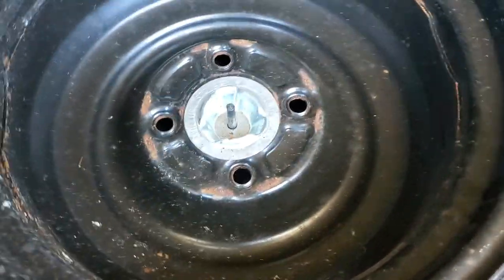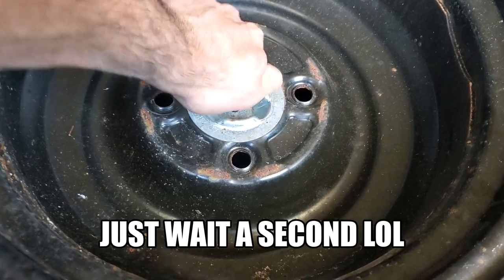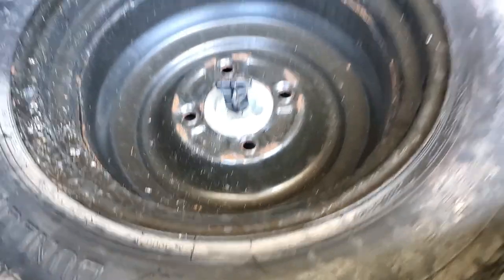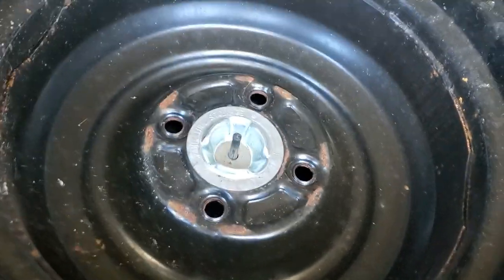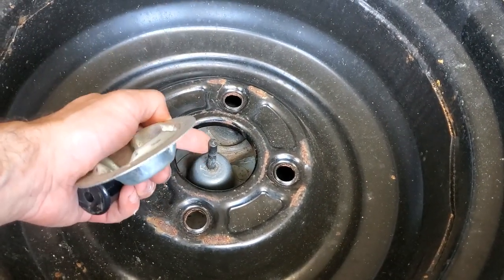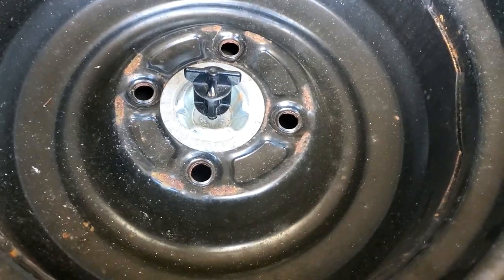This was quite strange — I've never seen this before, but there are no threads on this spare tire bolt. It's a nice-looking plug-style, you just push it down. I grabbed a spare from a 96 Accord — same bolt/lug pattern — but if you drove around you'd hear it moving back and forth since there are no threads on it. I have a threading tool, I could put some threads on there and add a nut. I don't want him driving around with it sliding and being annoying.